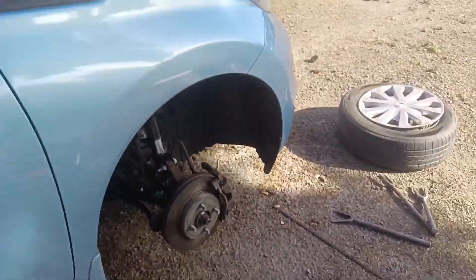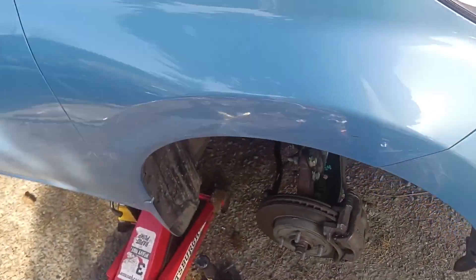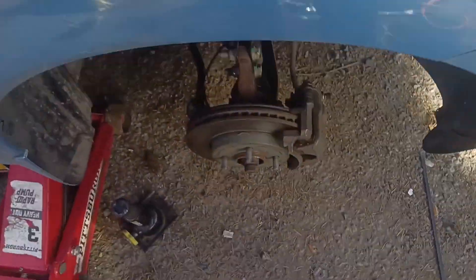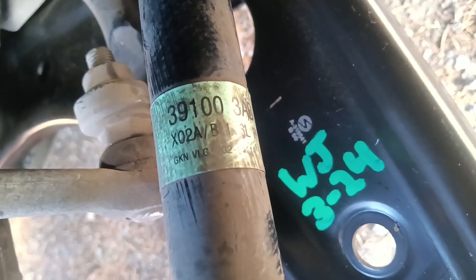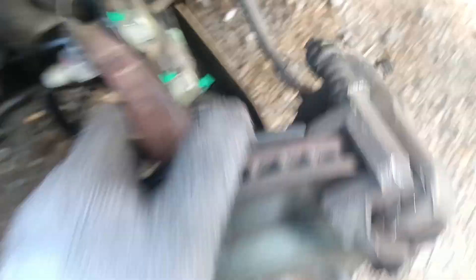It's been quite the full day out here, but we're making progress and I've got one more corner to go with plenty of daylight. We had a bad lower control arm — the bushing on it was all torn up. Not anymore. I've got it all in, all marked, everything happy. No kinks in my brake line. I just need to bend the dust shield back away from the rotor to keep that from making noise. One more side like that to go.